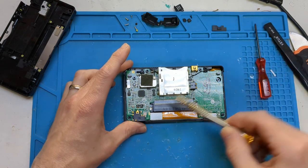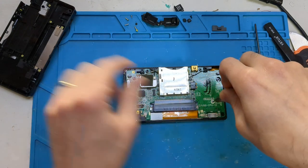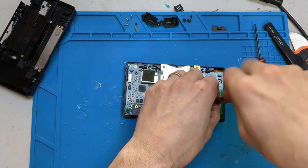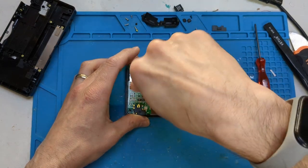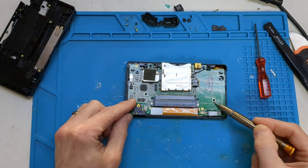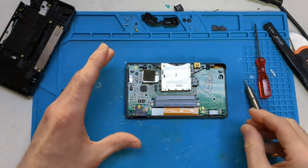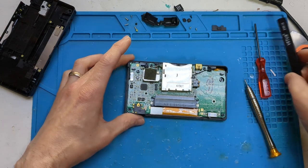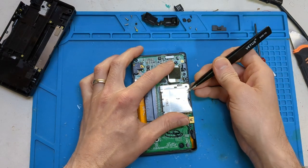There are another two screws here — two Phillips screws. These hold the main board down. This one you've actually seen through the battery bay before. You can tell that these ones are to be screwed here because they've got white circles around them. Next up, we've got to disconnect your Wi-Fi antenna — use a pair of tweezers for that. And your microphone — you just want to lift that up and then you can pull them out.